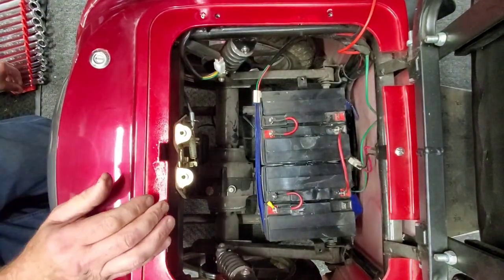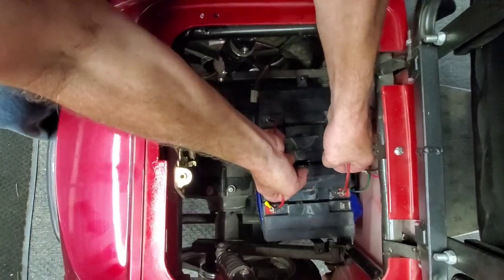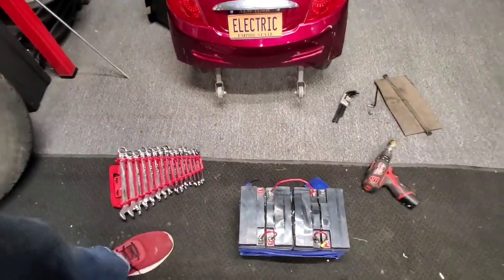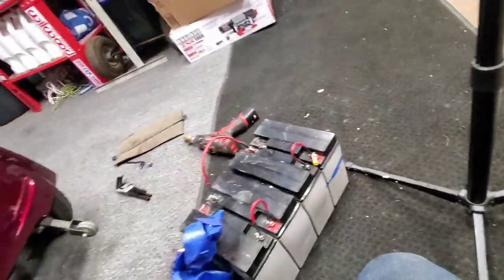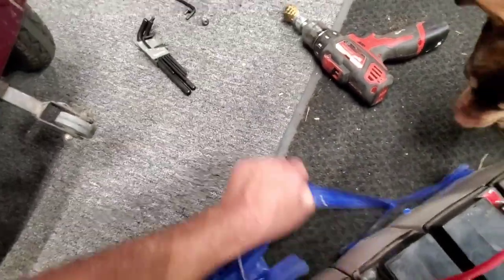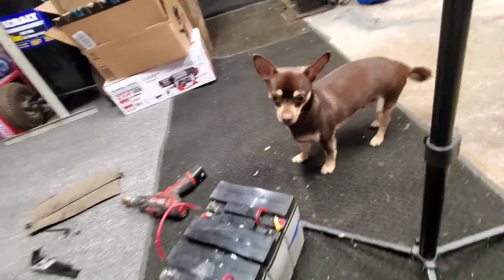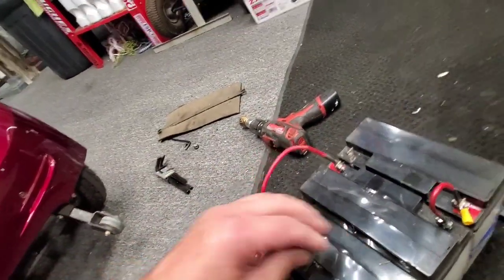Out comes... my little washer dropped down in between the batteries. So I can't get the batteries out directly. The way I usually take them out - they're taped together - I put a finger in each loop here and here, and you can wiggle them out like that. Now my batteries are out. Here is my whole battery pack, and I always tape them together - you just saw the reason why. I can see the batteries are very swelled up. Yeah, look at this - these batteries are all bubbled over. They're junk.